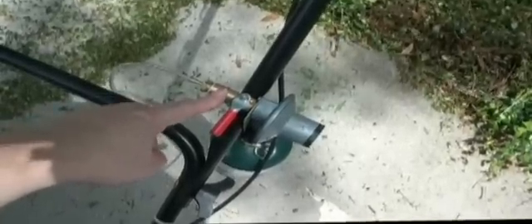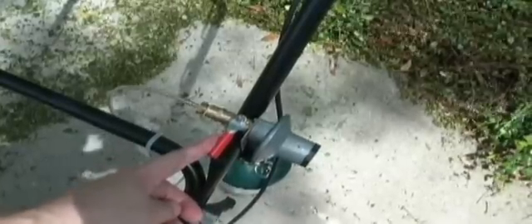One other thing I'd add: if I were to do this on a much higher budget, I would like to have another regulator between here and the propane line. There is a low-pressure regulator called a zero governor — the IMPCO Garretson type KN or type SD. What that would do is prevent any propane from flowing when I open the valve; the propane would only start flowing after the engine draws a vacuum through the Venturi. So it wouldn't leak if your engine stops. Those regulators cost about $70, and that's probably going to be my next modification.